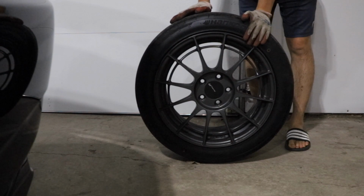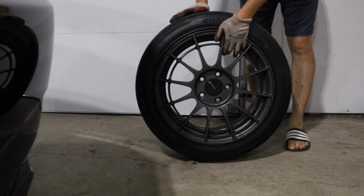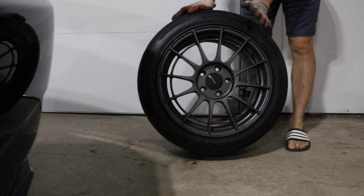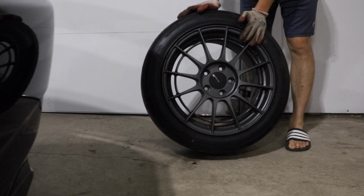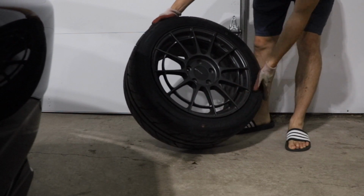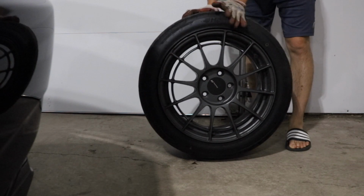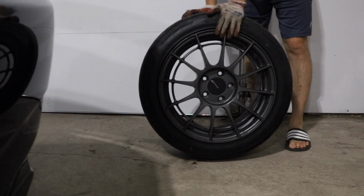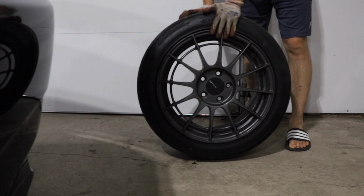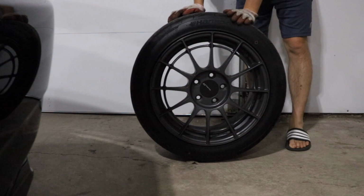So these are a low pressure cast wheel that are then flow formed. So they're not forged wheels per se, but they are kind of relatively close to that. Some of the lettering on here, the matte Dura technology that Enkei uses, is to try to get a relatively light and strong wheel from a casting. But yeah, so that is made it up to a Hankook RS4.